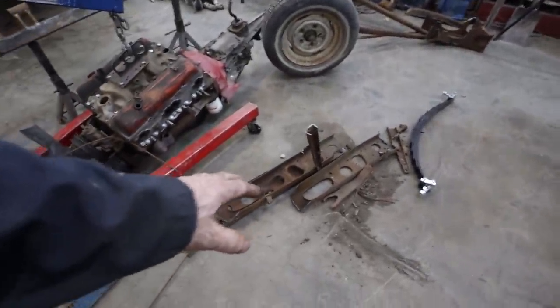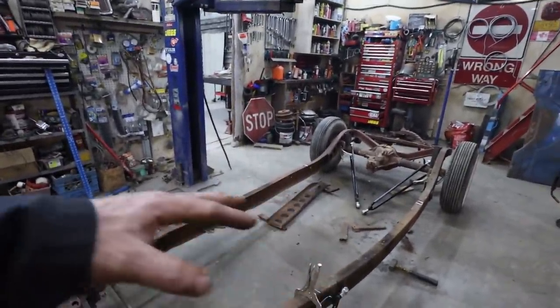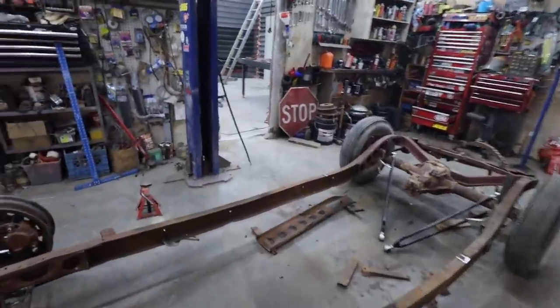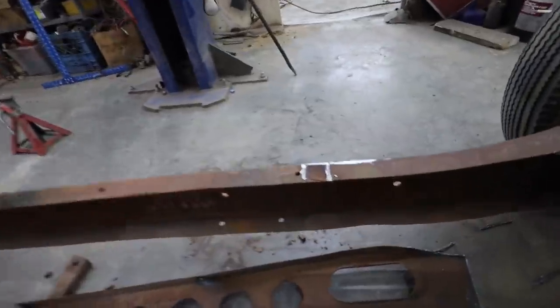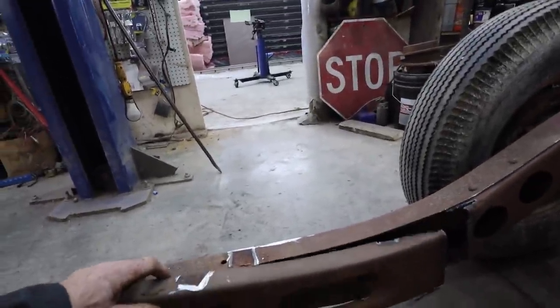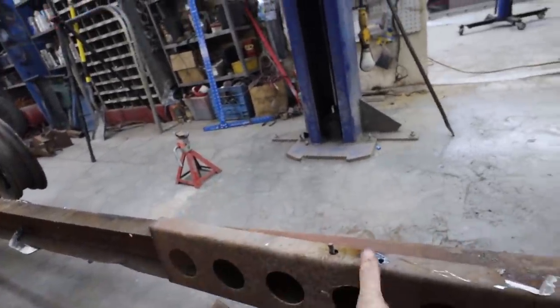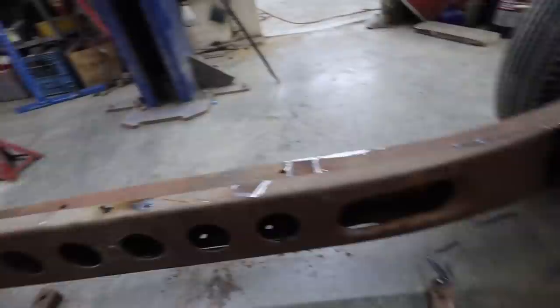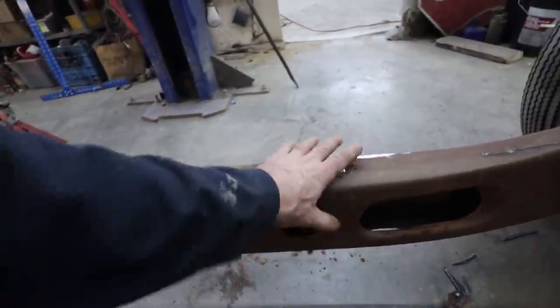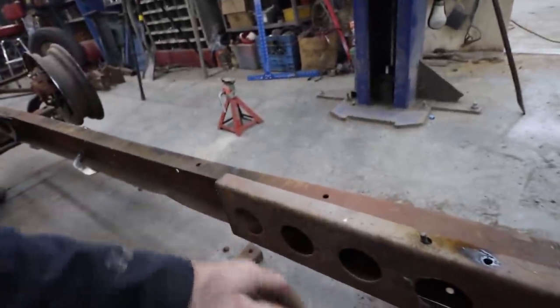Well, we cut the inner stuff out, nothing there. I thought I'd be smart and be able to lay it in and just use it as a gusset, which I'm gonna do, but it all needs to be trimmed up because I didn't realize it's actually thicker than the rail. Like it sits over top and bottom, which I guess isn't a bad thing. It'd be like a box perimeter frame or whatever you wanna call it, but I was gonna trim it up, just do it flush.